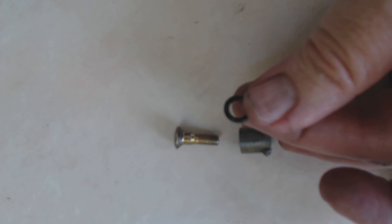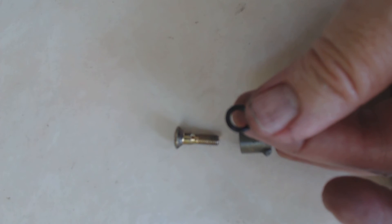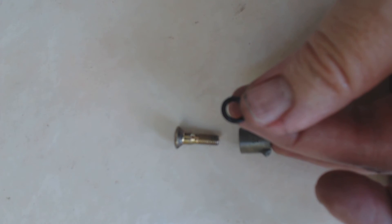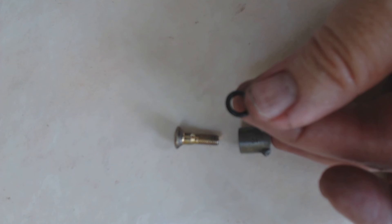When you're looking for an O-ring, make sure you get a nitrile, or as it's usually known, Buna-N. This material is good for 250 degrees and will resist both gasoline and ethanol. Do not use EPDM, as it will react with gasoline and not give you good service.